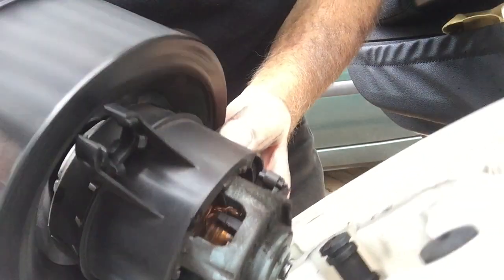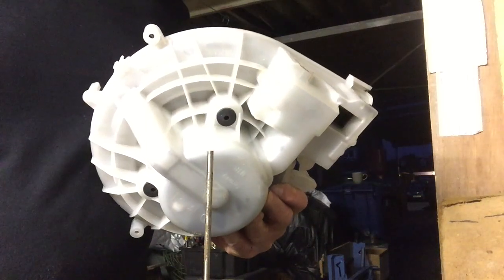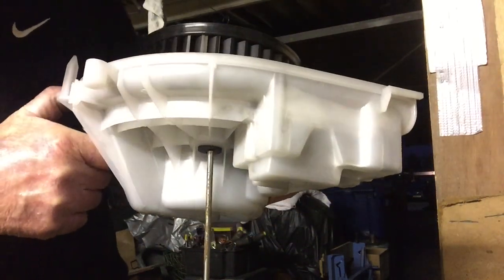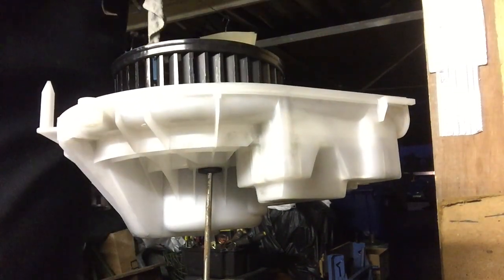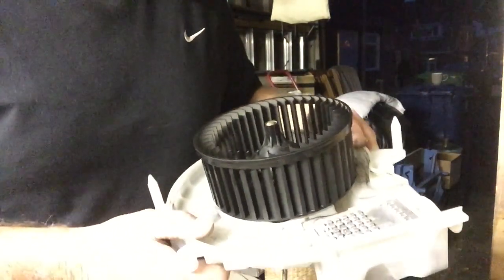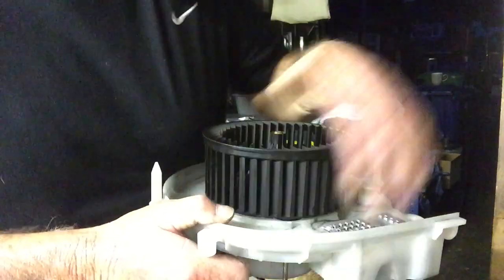Engage the retaining pegs on the motor fan assembly to the rubber vibration lugs on the fan housing and press them together. To fully engage the motor assembly to the housing, place a 4-inch long, 5mm diameter crop-ended rod into the hole in the center of the rubber vibration mountings. Place the other end of the rod on a firm flat surface, or as I did, in a vise, and push down on the fan at that location. Repeat this process on the other two mountings.